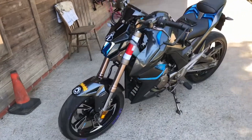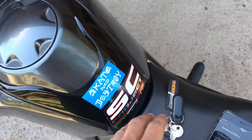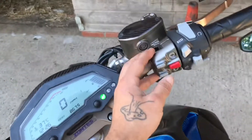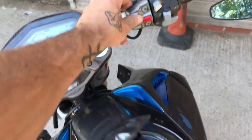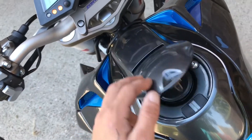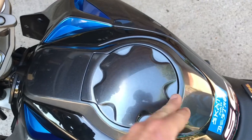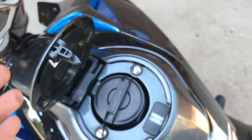So the first issue I had when I got the bike — as you can see now, all the ignition's on and everything. It's keyless. You've also got a seat release here and a fuel cap release here. Obviously, when you press the fuel cap button, it opens the fuel cap. When I first got the bike, that didn't work. Obviously, that can be quite a worry if it doesn't open, because you're thinking you're going to have to break it to get fuel in. What you were able to do is press the button and press the cap at the same time — if you did that, you'd be able to open it.